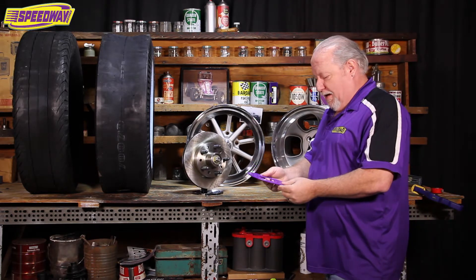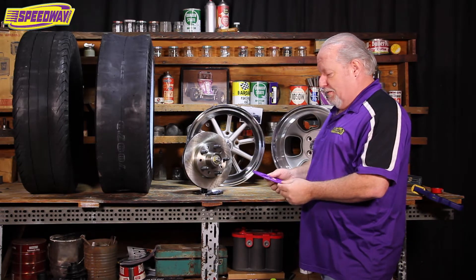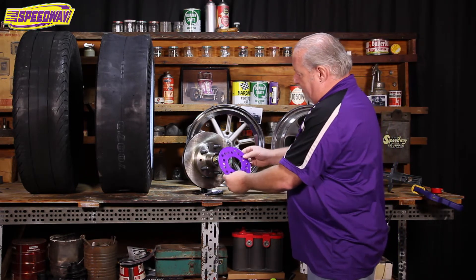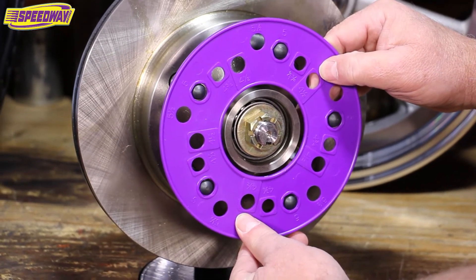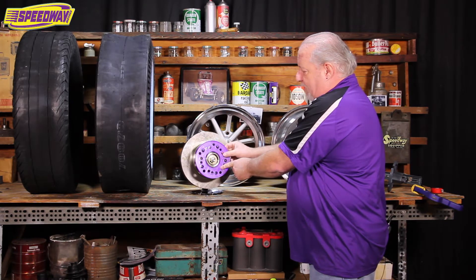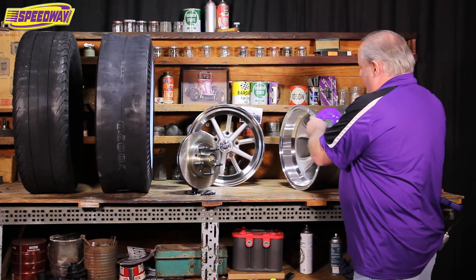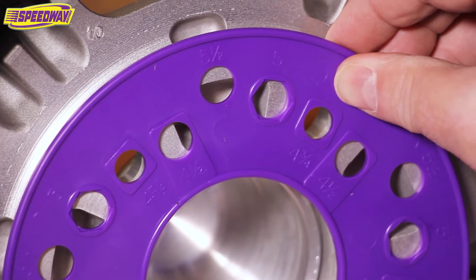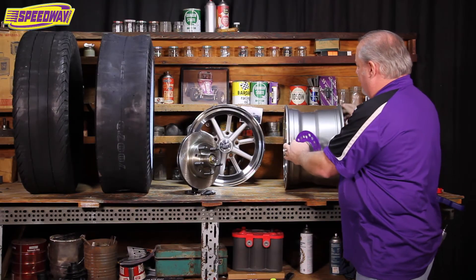The second little deal I brought is really handy. It's our Speedway Motors bolt circle template. I carry one of these all the time in my toolbox. Go to look at a set of wheels or an axle or something like that — it just slides over the lug nuts much like that Percy's tool did. It'll tell you what the bolt pattern is, so you don't have to worry about trying to measure it. This just happens to be a five inch bolt pattern. You can also use this when you measure the wheels — just slide the wheel around, fit it up against there, line up your holes, and match it up with the numbers on the inside and that'll tell you exactly what wheels you're getting.